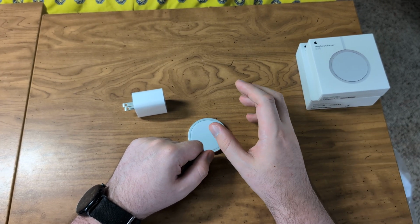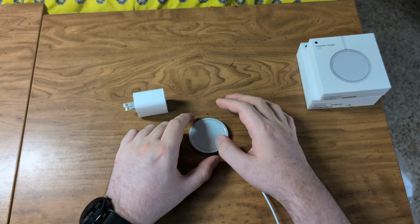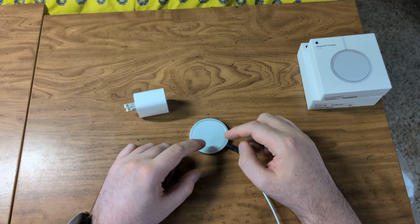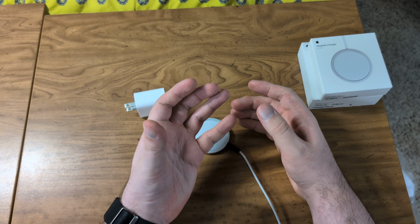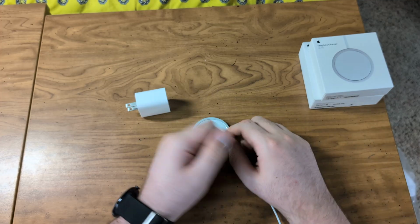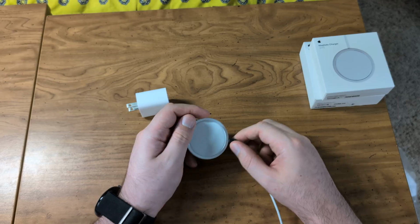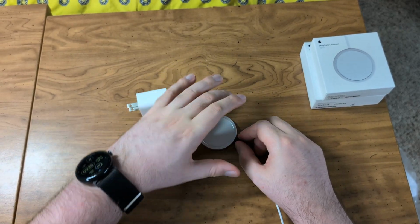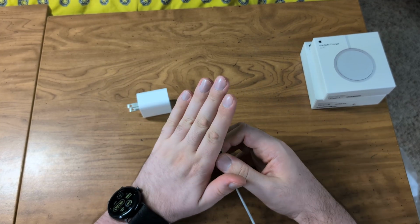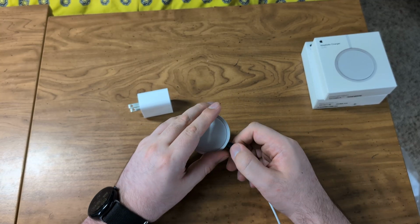Not that it was hard to align wireless, but on some of the higher end ones, like Samsung and other brands till then, they actually started doing multiple coils to make it easier to line up your device. Like the high-end Samsung one that kind of looked like a plush pillow actually had 3 coils in it, as well as being air-cooled, which is crazy. It's because people weren't lining up, so they made it easier to do that, right? Now with MagSafe, you can just have one big coil because boom, or now Qi2, bang, it is in there.